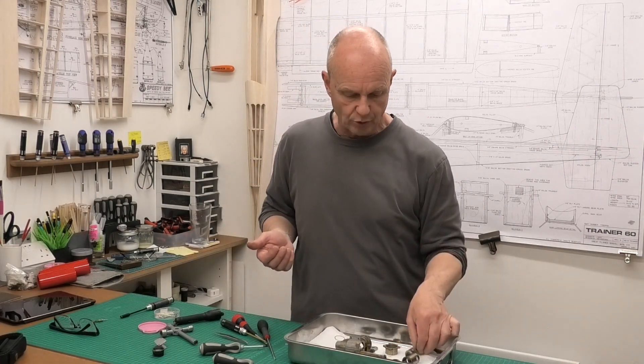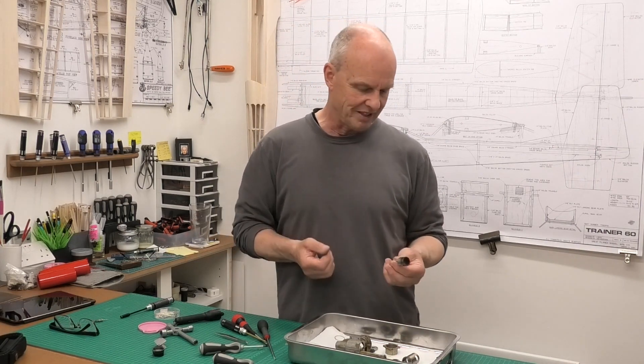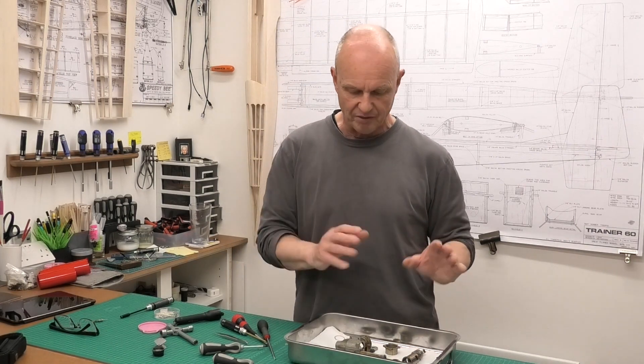The piston is an ABC piston - it's not magnetic - so this engine is going to date from post-1993, making it a slightly later version. It's still in good condition, except for those score marks which possibly came from a bumpy landing sucking in a bit of dirt at some point. But I don't think that will affect performance.